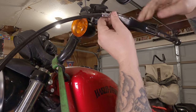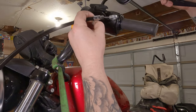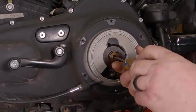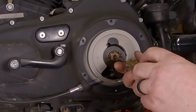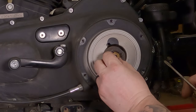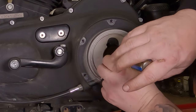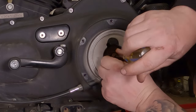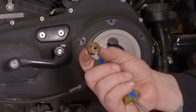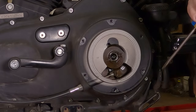To remove the cable, just take this plastic pin right on out of here — cable comes right out. Take your smaller screwdriver and crank that all the way in there too. This little nut is going to want to fall out of here; you can actually take it out in your hand. You may have to hold the screw in the center and thread them apart. Take that and set it in a clean location — this is internal mechanical parts; you want to keep these super clean.